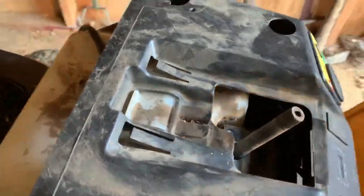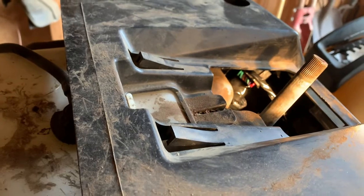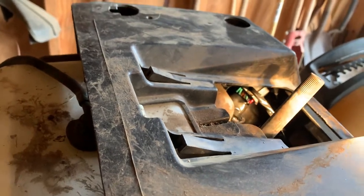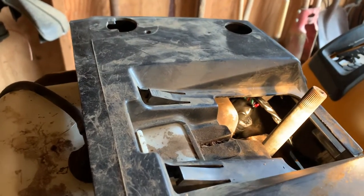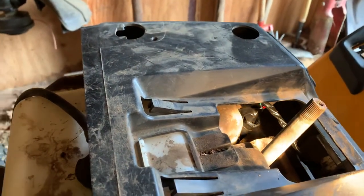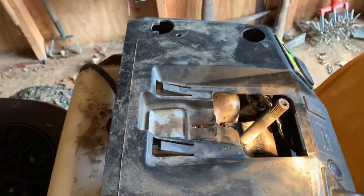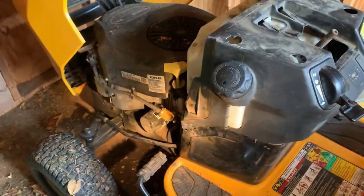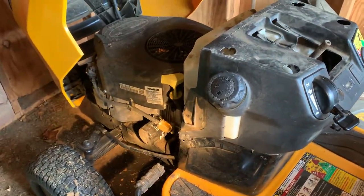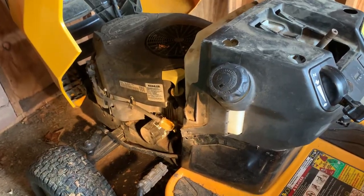At this point, you can get in there, you can put your hand in there, you can get that connector back on, and if that's all you need to do, that's as far as you need to take this apart. I've retaped that and added a little bit in order to prevent any more potential mouse damage in there, but I wanted to get a little bit further, so the next step, if you wanted to do what I did, which is clean out all the stuff that had gone in there between leaves and sticks and mice that tried to make nests, there's going to be 4 bolts.